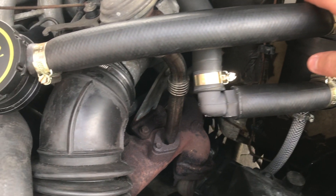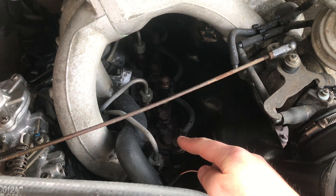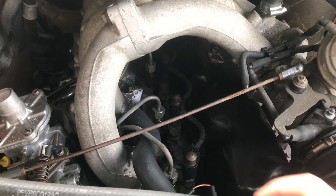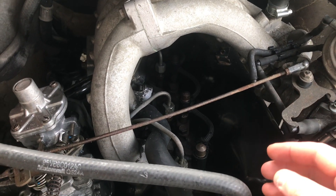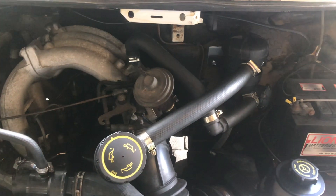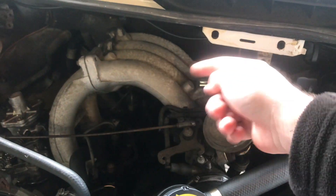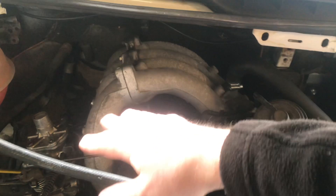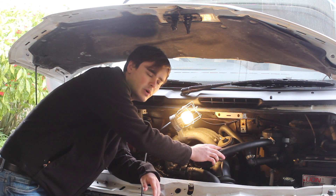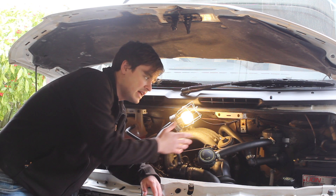Hopefully the oil catch can will also mitigate that problem. This engine is direct injection, meaning the injectors spray fuel directly into the cylinder, whereas with a port injection engine fuel is sprayed on the back of the intake valves, effectively cleaning them. A DI engine is therefore more prone to carbon deposit build-up on the back of the intake valves, which over time causes restricted airflow. Now that the oil catch can is installed alongside the EGR blanking plate — so no exhaust soot is going back down the inlet — when we do clean the inlet manifold it should stay nice and clean. Only time will tell if it works; I've reset the trip counter to track mileage and I'll keep you updated on whether it's caught any oil.